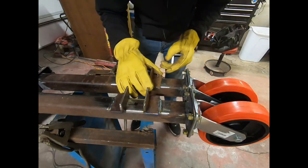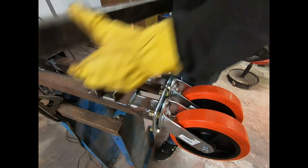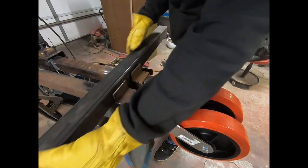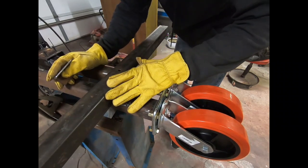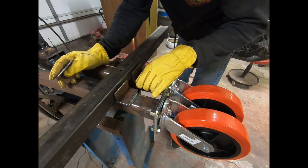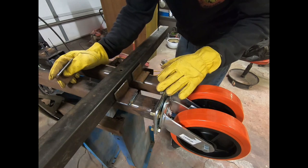And then pick up your pieces that you dropped on the floor. And you can square them up like that. I'm gonna move you all over here. Lay our tube between them. See where that hole is, the center on this particular piece. I'm gonna push it right up against this side, so there'll be a slight gap here. Put it up against it and just drag it off a little bit. Make sure your gap is parallel, not wide on one side. That should work there.